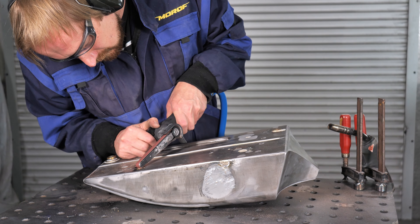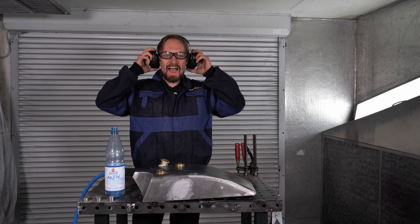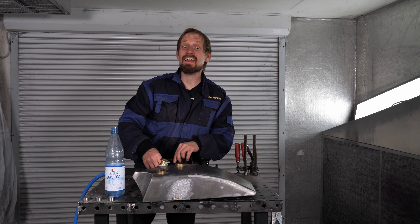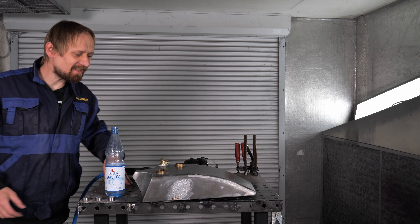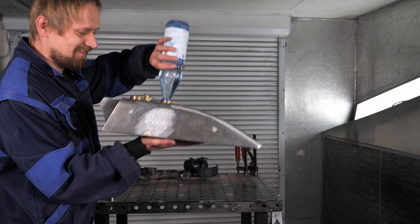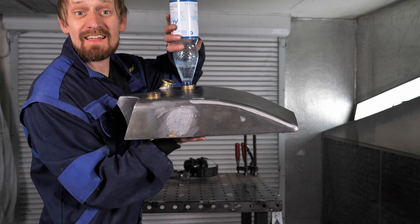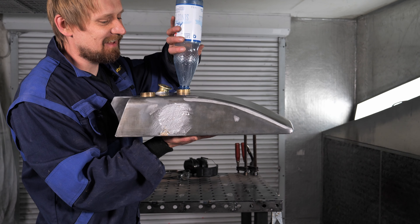It's dripping like hell, and the reason I'm filling in water is to get rid of all the gasoline fumes — that's very important before I can start brazing. If I don't get rid of all the fumes I could provoke a big explosion, which I'd like to avoid. So I'm washing the tank with water. I shouldn't ruin it — it's a one-of-a-kind piece, 98 years old.